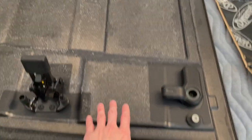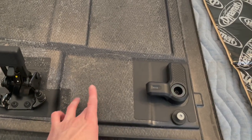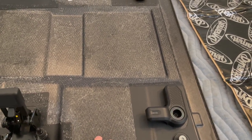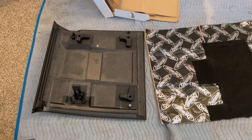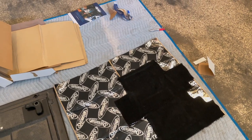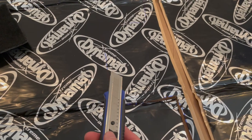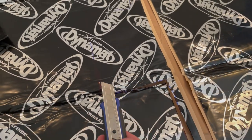I'm not going to bother cleaning with Goo Gone or any alcohol cleaner because the surface is still pretty tacky. Since it'll be under the Dynamat anyway, I think it might just provide more adhesion. I don't think I'll have any issues with the Dynamat falling down. I've pulled off the liner from the first piece, laid down two pieces of Dynamat, and traced the outline in blue and red Sharpie. I'm cutting on top of cardboard with a regular razor blade — this works better than scissors, which get gunked up in the butyl rubber.